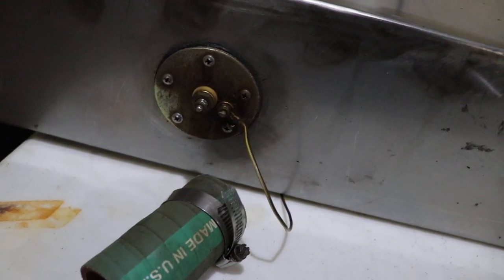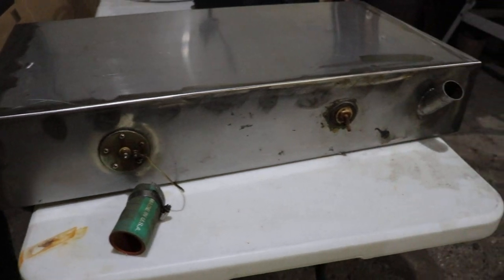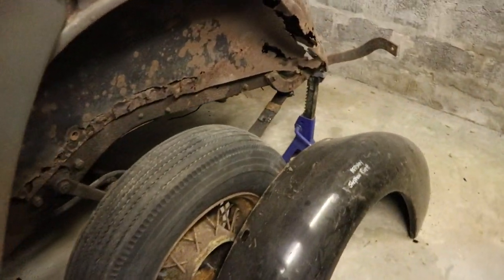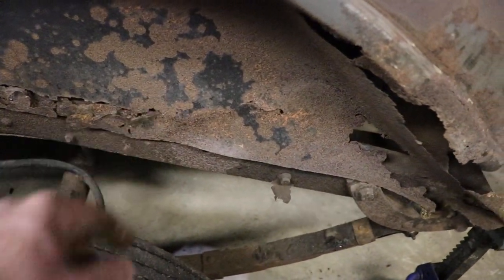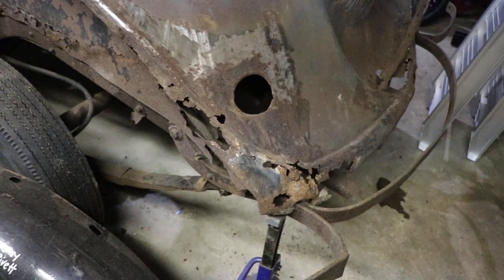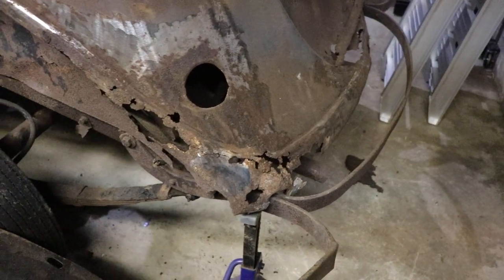Working with a six-inch tall tank may be a bit difficult, but take a look and keep this in mind. This would be facing forward on the Hupmobile's filler side. The fuel tank goes in behind the differential underneath that hump — I don't have the fuel tank here right now, it's in another town. The fuel filler on this would end up being under the fender, which is not where it's supposed to be, so I'd have to chop it off and run it through this hole here. A 34 Ford fuel tank looks like it can kind of fit, but they're about five times what I paid for this tank. I think I can make this tank work.